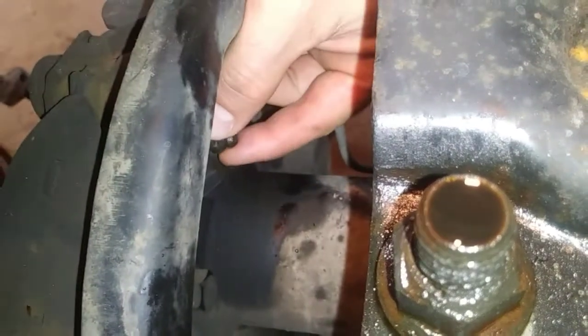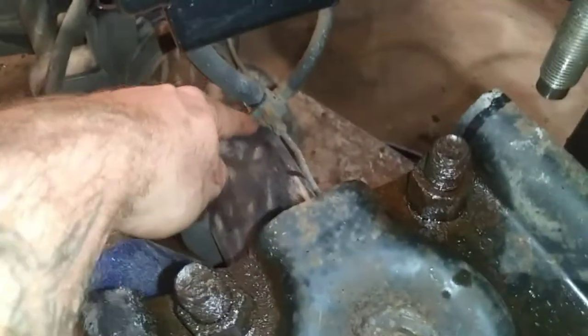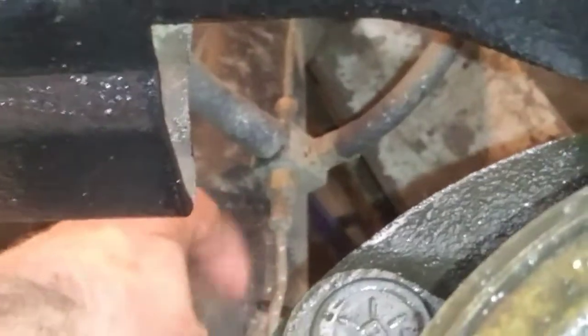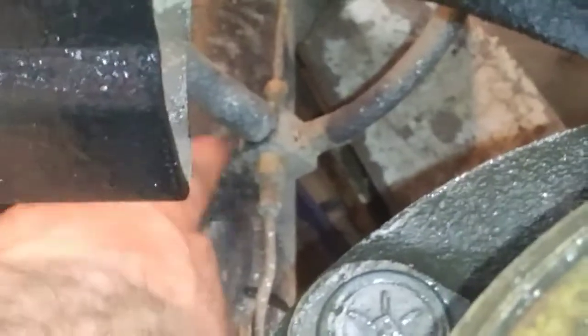I'm on the back of mine and you can see how that bleeder is loose right there — it's been loose like that for the last 10 minutes and nothing is coming out. That means I've got a problem. So I go up to where the T is — that block right there. This line right here is the inlet, that far line goes over there, and this line goes to the brake cylinder over here. That other tube is just axle ventilation.